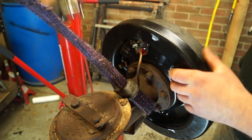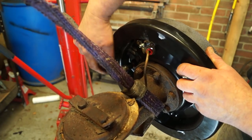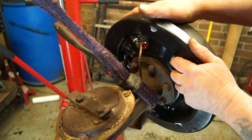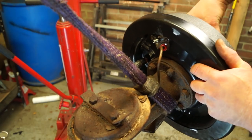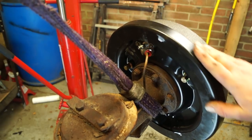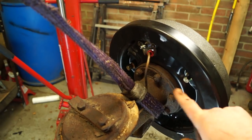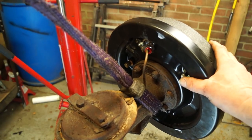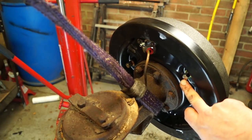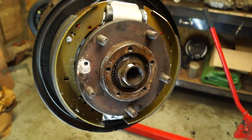Make sure you can turn the wheel and hear the brake shoes just kissing the drum — that's fine. Take them up one notch at a time to centralize the shoes — centralizing is important. Recheck them again. If you're not sure, take it for a drive, use the brakes a bit to bed them in, and then readjust. You don't want them binding when hot, and you don't want them so loose that the pedal has too much travel. Adjust these on a service interval — don't wait until the brakes feel bad.